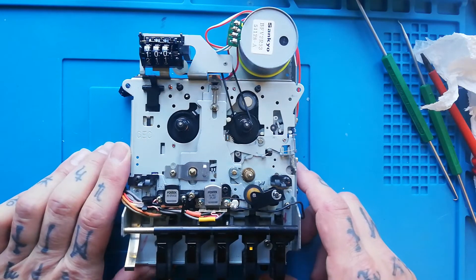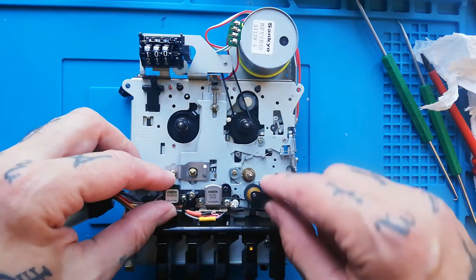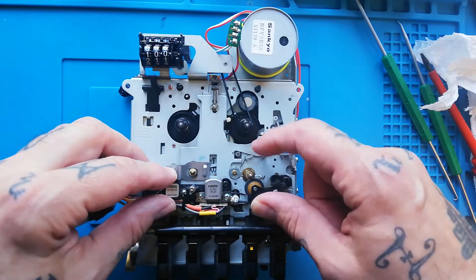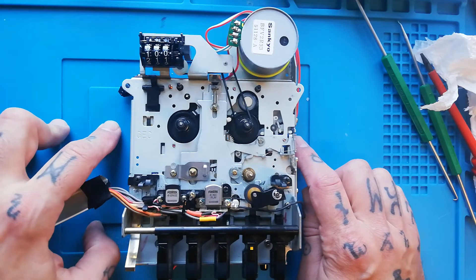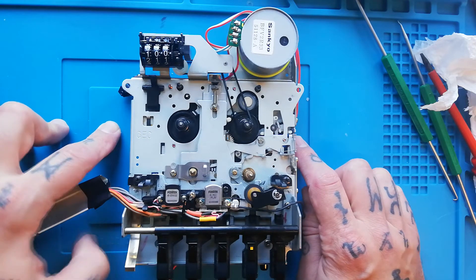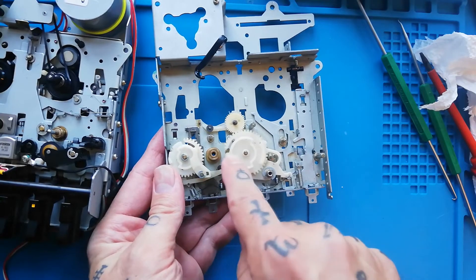Your problems with playback mode are going to be of two broad types. One is where the magnetic heads and the pinch roller don't raise all the way up to meet the capstan. With any problem you want to check that you've got new rubber in there first. I've already done videos on replacing the various belts and demonstrated how to remove this plate and the gears beneath.